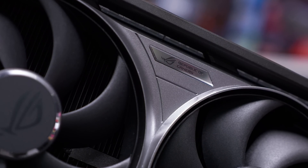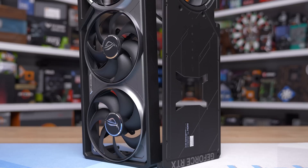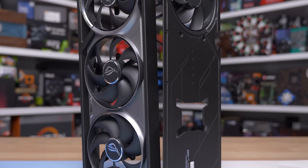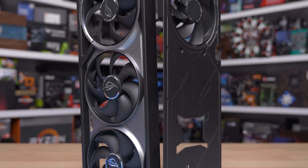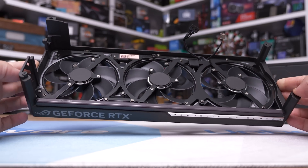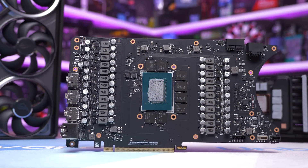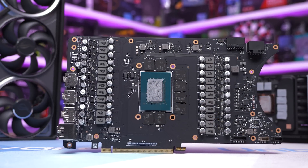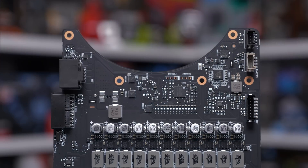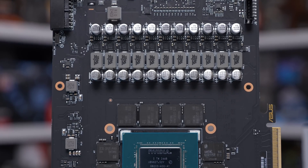Taking the cooler off is a pretty straightforward job — in total there are fewer than two dozen screws holding it together. With the screws removed, you disconnect the fan and LED cables, allowing the aluminium fan shroud to lift off. You then carefully apply some lifting pressure to the heatsink and wait for the seal created by the thermal pads to break. This reveals the PCB, which measures 260 millimeters long and 145 millimeters tall — quite a bit bigger than the other RTX 5080 and even 5090 PCBs I've seen so far.